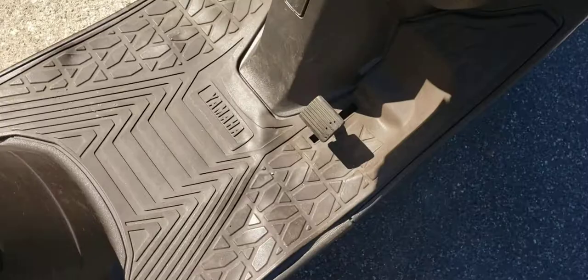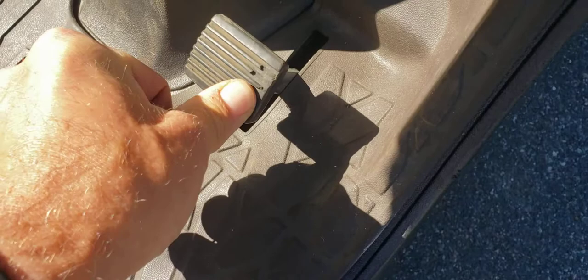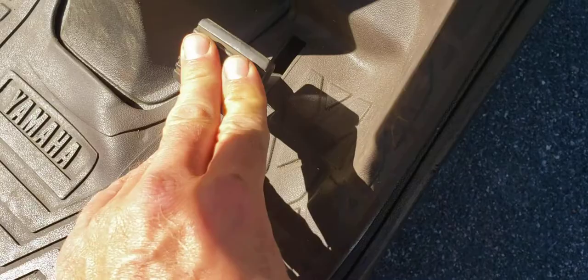Down here on the foot, you can see this scooter's got a foot brake. What you want is some top pedal free play — they call it — you gotta have like a couple inches, two to three inches. If it's rock hard when you step on it, that means the rear brake shoes are dragging on the drum. You do not want that. Same up here on the old mopeds.